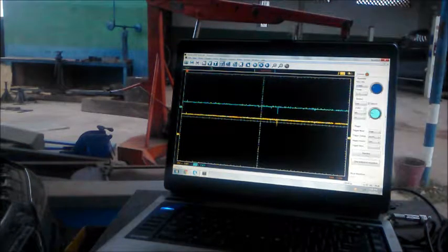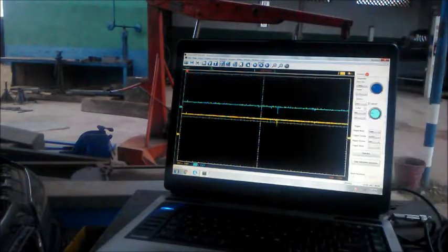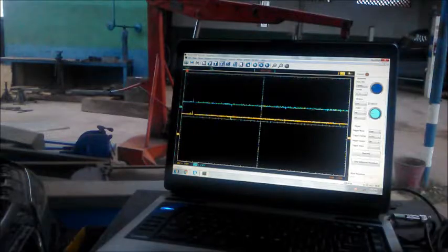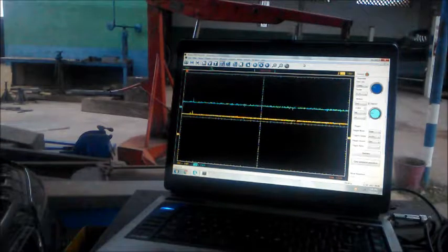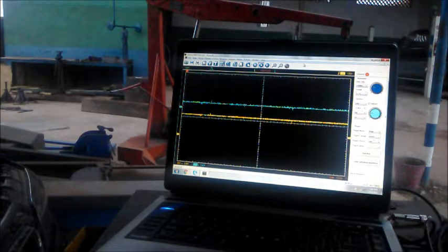I'm going to do it again, and then since the vehicle has been running for 3 minutes now, it may have warmed up, the problem may actually clear again on camera. I'm sure you all heard that. I think it has set the fault code. I'm going to turn the key off in the ignition switch off for a few minutes, and then repeat the test again. If this time the throttle motor moves, then it means it's open when cold.